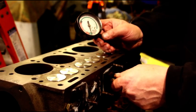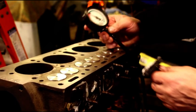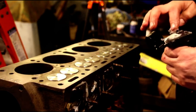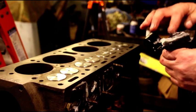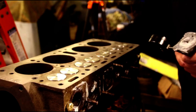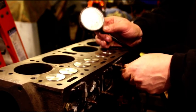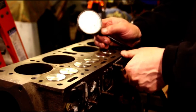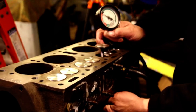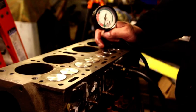There's another exhaust — pulling 20 on that one. If your engine builder doesn't want to show you this, he might not be the engine builder for you. I show this to everybody so they can see that their valves are sealing. There goes another one — we're pulling 20. No spring on that, just the three-angle valve job. Metal to metal, we're pulling 20.